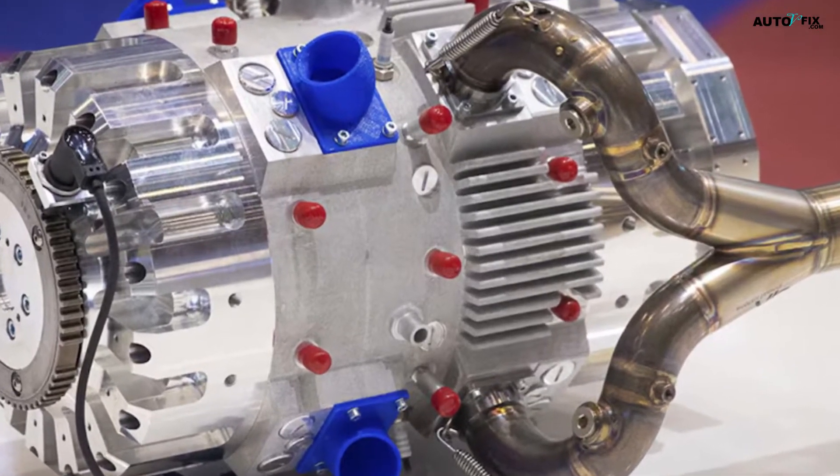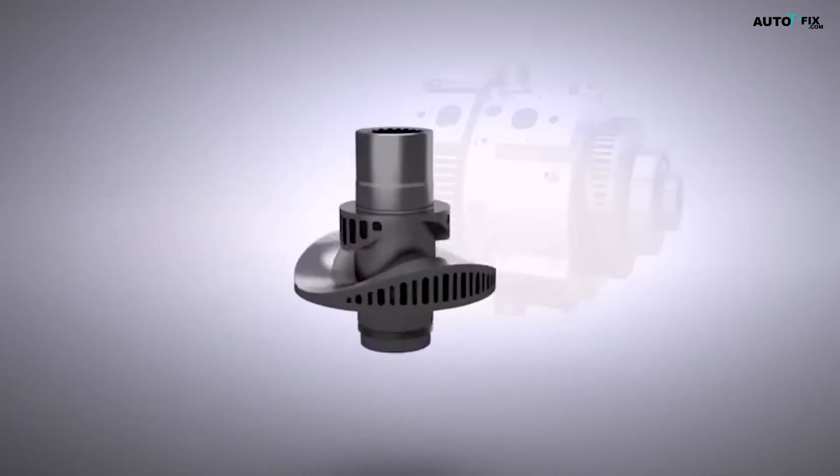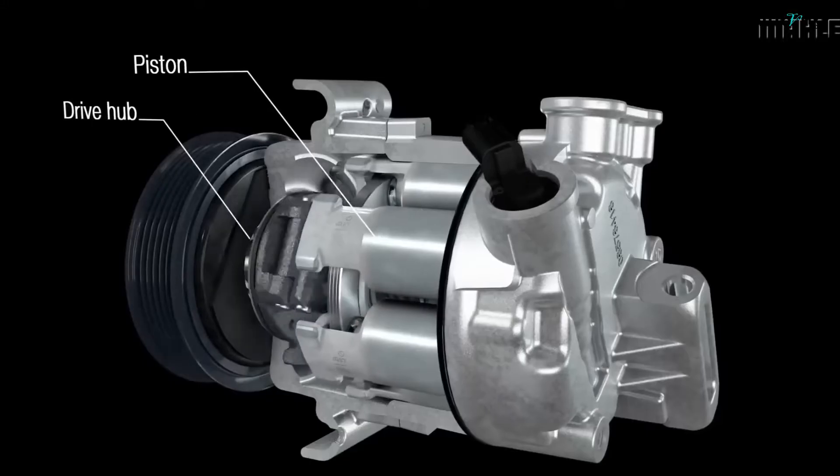This is achieved through its unique design, which features opposed pistons that push away from each other, driving a wavy swashplate. This opposed piston configuration, combined with the innovative swashplate, helps to balance the engine and reduce unwanted vibrations.